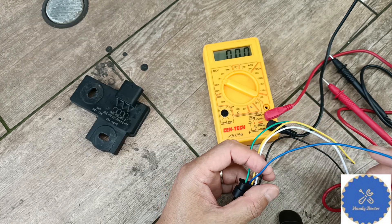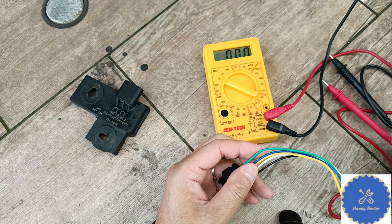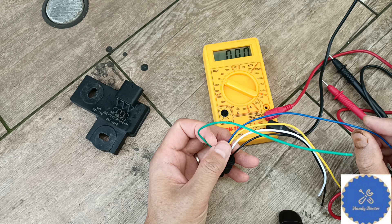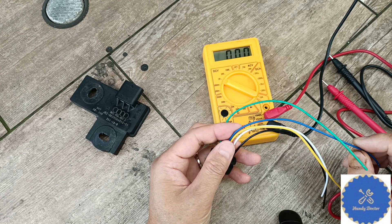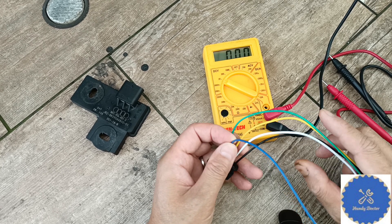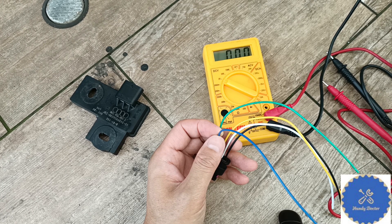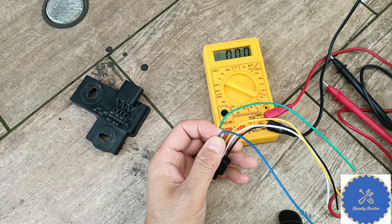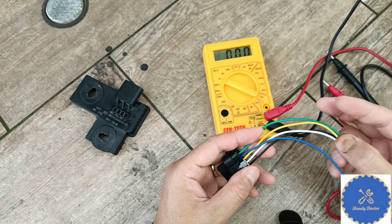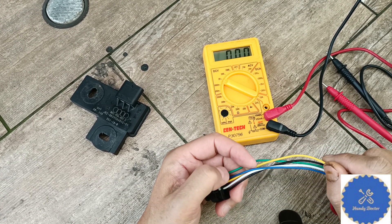Another suggestion: if you see something like P2025 or P2026, just wait. It should become P2024 in a week or maybe a month, unless you have inspections due. Nothing wrong to wait, honestly. There's no drivability issue — the car runs perfectly fine. It's just an annoying check engine light, and maybe a little bit worse in terms of pollution — not so good for the environment, but that's all.